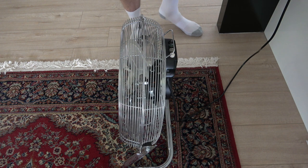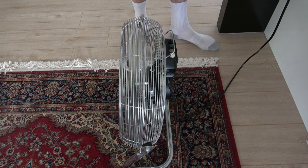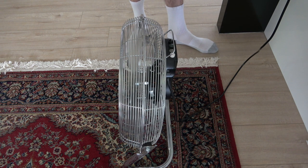First of all, full power - and turning it down a little bit so it's not so noisy. Now listen as I turn the level down. I hope you can hear that buzzing, which is clearly unacceptable. You can't operate the fan under such conditions. It does actually vary the speed, but you can hear the buzzing, which is the triac basically sending out square waves into the power supply. It makes that noise right up until when it's on full and the triac is basically out of circuit.